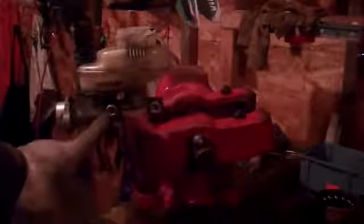We have our two brake lines that connect here like this into our fittings, and the other one here. And the reason I have the two of them instead of one is for safety's sake. The front and the rear braking system of the vehicle are fed independently. In case there's a catastrophic failure in one part of the system, you will still have brakes either front or rear.